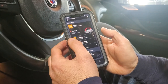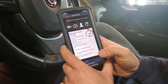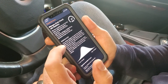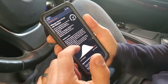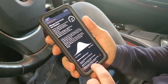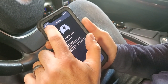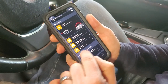This is going to scan all of your trouble codes. One of my favorite things is the used car check - you can see if the mileage corresponds between the different control units on the car. Because there are so many control modules that save the mileage, Carly can check those modules to read out what they say, and that way you can compare them. This one is coming up as good - it's saying 115,000 kilometers, which is really about 71,000 miles. No higher mileage than dashboard indicated, so this car has not had the mileage played with at all. There are cars out there - I've seen them myself - where they've rolled back the digital cluster, and most people would never have any idea. And now with this, you will know.